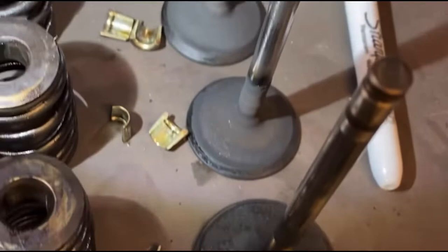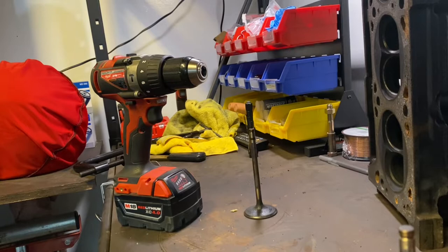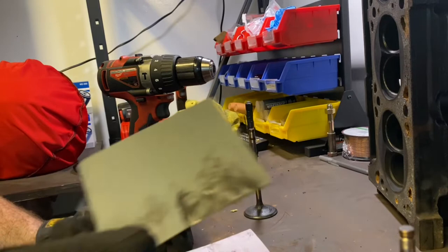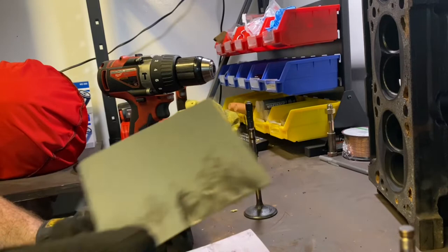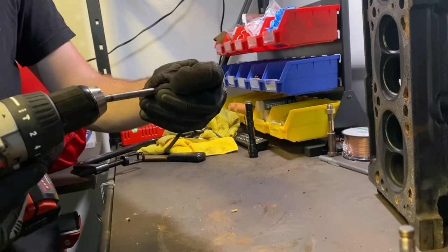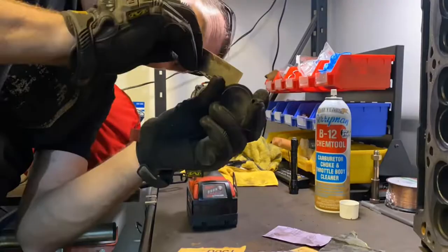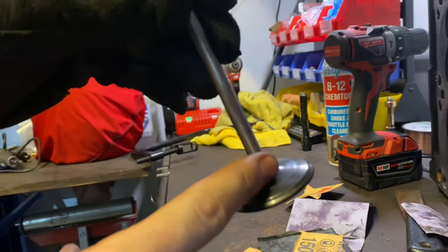To get these valves clean, I don't have a drill press in the garage here, so I'm going to use my battery-powered drill. I've got some 320 sandpaper along with some 1500. The 1500 is really going to be the polish at the very end; the 320 is going to get most of the carbon off. The buildup on this was so bad that I had to use a brass scraper to get some of the heavy deposits off. Once I was able to do that, the 320 had no problem taking the rest off and that 1500 gave it a nice polish at the end. Here is the finished product — extremely smooth to the touch. It still has some discoloration but that's fine.